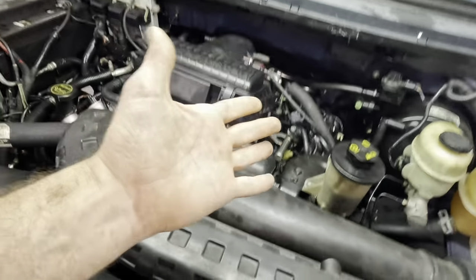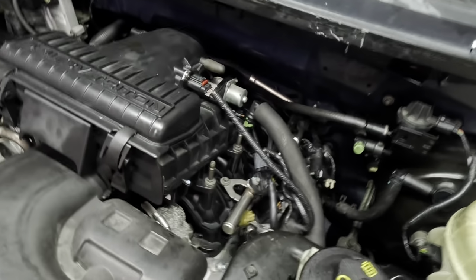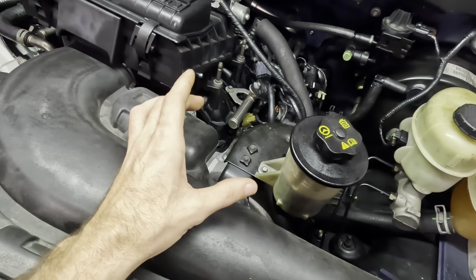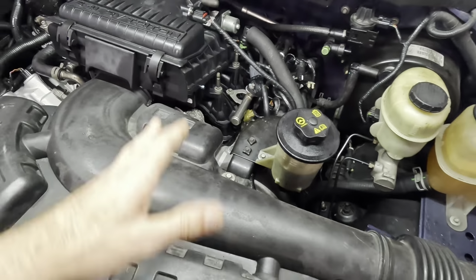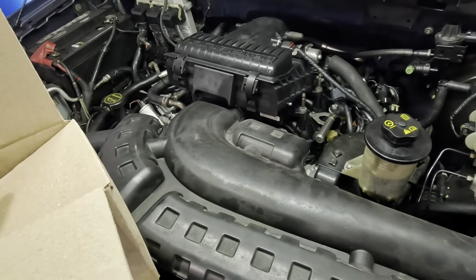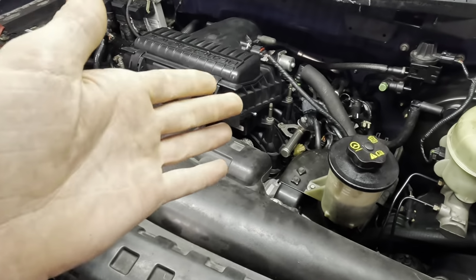So, back to the warranty company, or the company that built the engine. We had heard some internal noises, and based on what they wanted to do, they told us to replace one of the camshaft phasers under the timing cover, under the valve covers. They had me do the driver's side. What happened after that is the noise was still there, because I don't believe this thing has a timing phaser issue. I believe it has a bearing problem or an oil pressure slash flow problem.